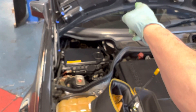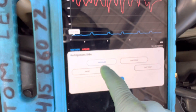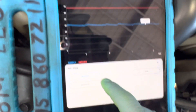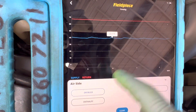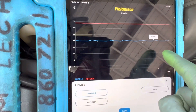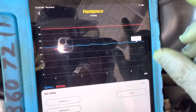The pressure is matching up to the temperature coming out of the dash at every cutoff. You can see the pressure outlined, and then you can see the temperature coming out of the dash — the high temperature is 41 degrees. So around 41 degrees is where it kicks the compressor back on, then it slowly slopes down, getting colder and colder, and then it hits 39 degrees and sends the signal to turn off the clutch.